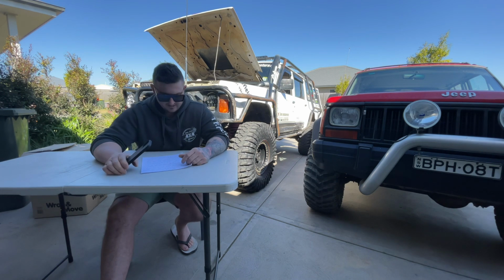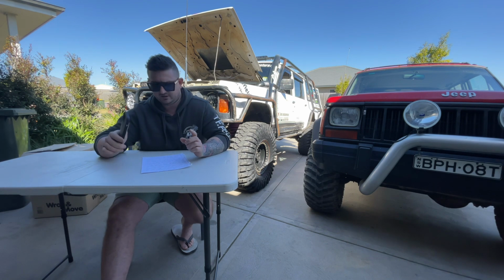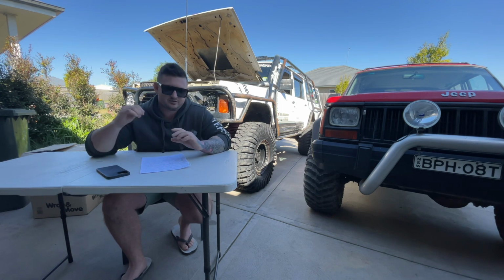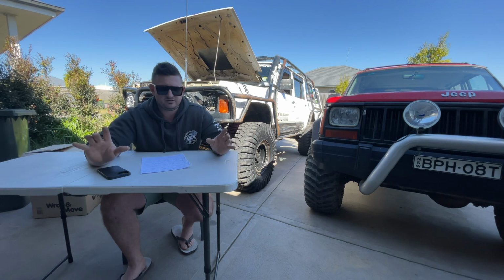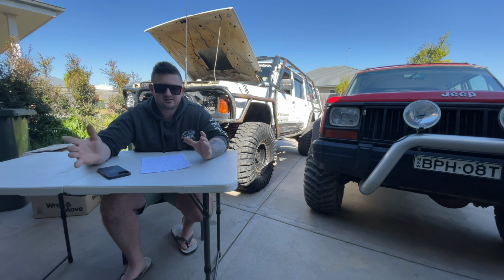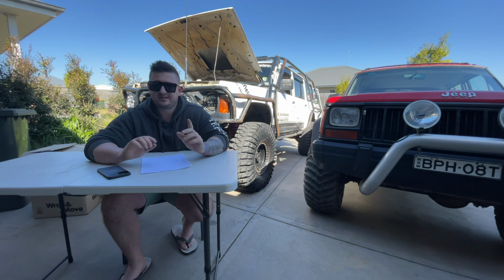Mate, thanks for that. Mitch _ TI, run down on the 5-link and the rest of the suspension. Alright, so the 5-link, I'll just clear that up. It's not a 5-link, it's actually called an Xlink, and that's what I was pointing out earlier in the video. It just mounts to the front of the diff. Really good and cheaper option. 5-links and Xlinks, there's not a big difference. Both still got to be engineered. The only thing with the Xlink is they're a little bit cheaper and quicker and easier to fit.